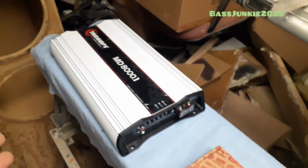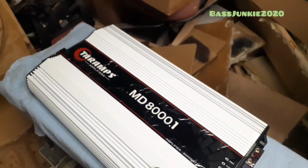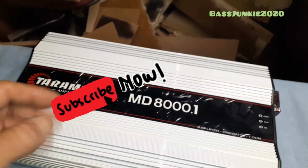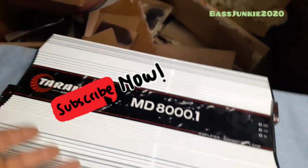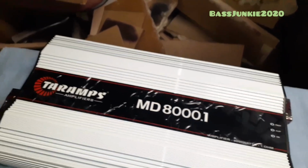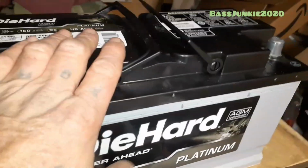The batteries I got will definitely power this, because I was just playing a song. I was going to do a demo for you guys, but that Smart 3 keeps going into protect quick now. I think it's because my voltage is dropping really fast. I think I burnt those two little batteries out running those three amplifiers. But there's only going to be this amp and the four channel, so with this battery right here, I think I might be all right.